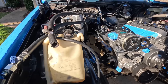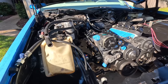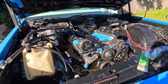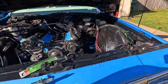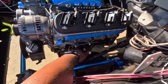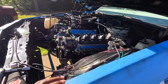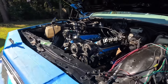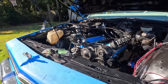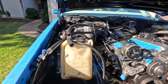It's off a little bit but that's gonna straighten up once we put that transmission in. We're gonna get everything squared away and lined up. That's why I ain't gonna tighten up any of the slide mount bolts right here — I ain't tightening up none of those until we get the transmission in. Gonna grab an oil filter and some spark plugs and stick them spark plugs in. I got them headers I need to be working on.